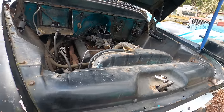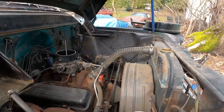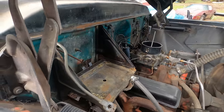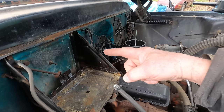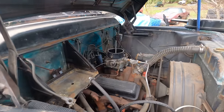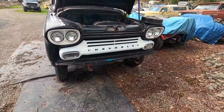All right, folks. I'm going to just set you up on the tripod. I'm going to get my oil topped off, get the radiator topped off, throw a battery in, and I'm probably going to take this bolt out of the end of this fuel line that goes to the tank and see what happens when I blow through there. Let's get started on it. I'm excited to get old Ram Jam, my Montana truck, running. I'll be back.